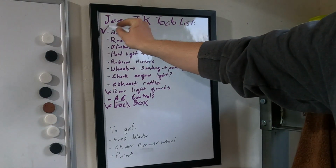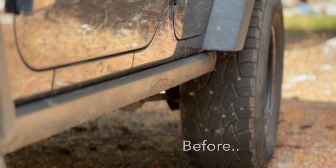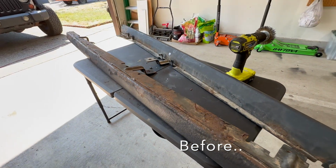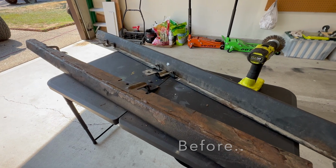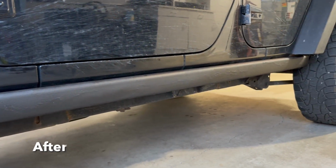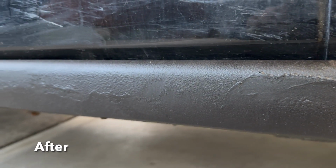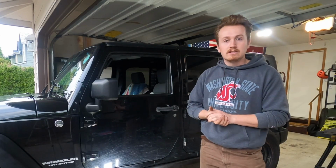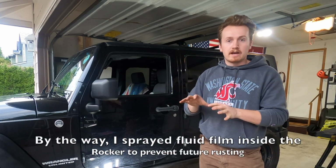Well, I've been some guy, and this has been refurbishing the rock sliders on this 2010 Wrangler Rubicon. It was an interesting process that I thought would have taken me less time than it did. One thing that I've already touched on, but I definitely think I'll be taking forward in projects: I should have probably just committed to getting a paint remover, a stripper, something real toxic that just gets all that stuff off of there, because using a mechanical method such as the angle grinder or the rotary sander to get that off just gummed up the sanding pads. It was impossible. And so I kind of figured whatever, it would all blend together afterwards. As long as it wasn't an area with rust under it, I didn't care to remove it. And I can definitely see that in the after shots. I can definitely tell the areas that have that pre-existing texture from the areas that just have the fresh paint.